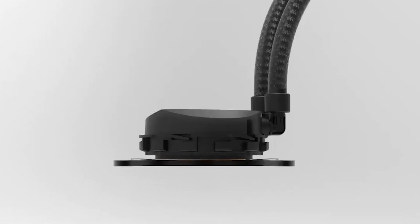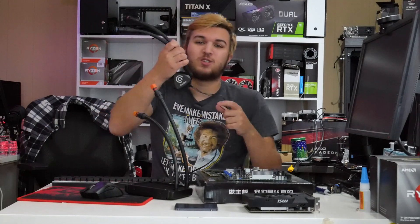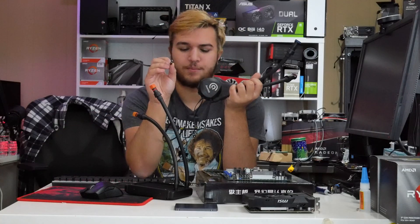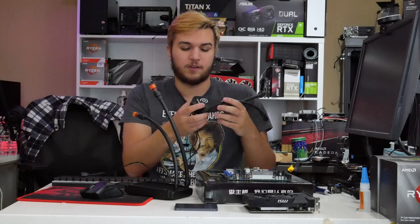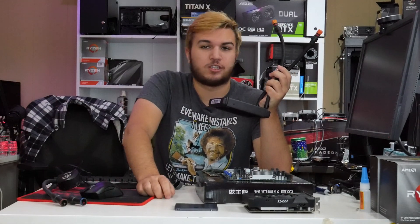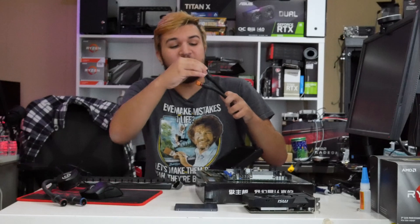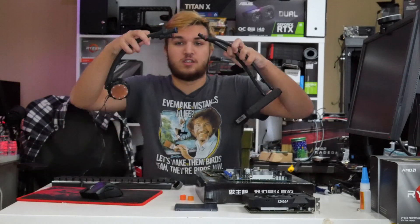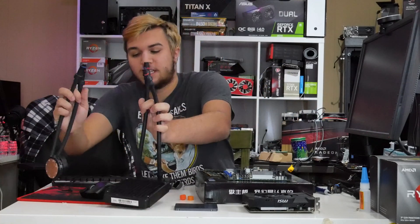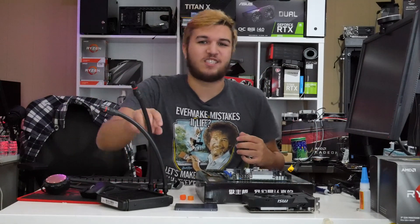I believe this is a Gen 6 Asetek pump with, I believe, two foot total of tube length, although I'm not sure. This is also an RGB pump block — one of these daisy-chainable 5-volt RGB headers — and it's got a standard 3-pin pump header for power. We have a pretty simple, thin, 120-millimeter radiator. The amazing part of this cooler is that these quick disconnects can basically be used to connect these at any point, meaning you could weave the tubing around a build and connect it at a weird part of the case, instead of being stuck in a configuration where the pump and radiator have to be mounted next to each other. This allows for some pretty awesome stuff.